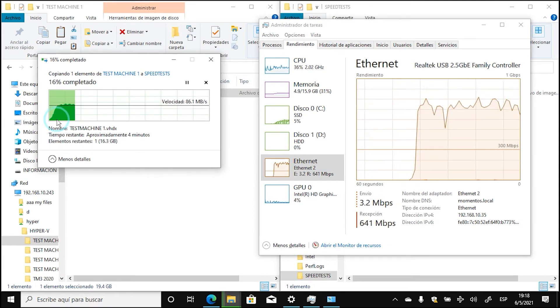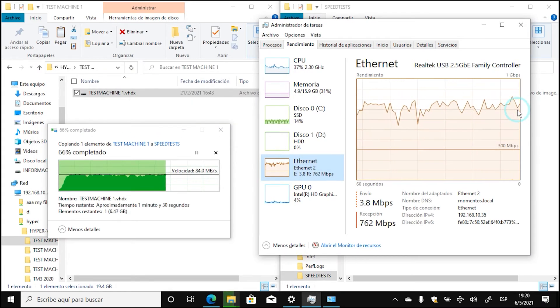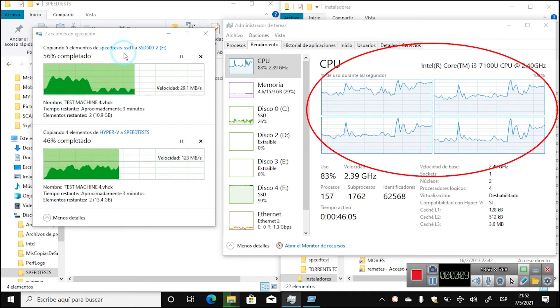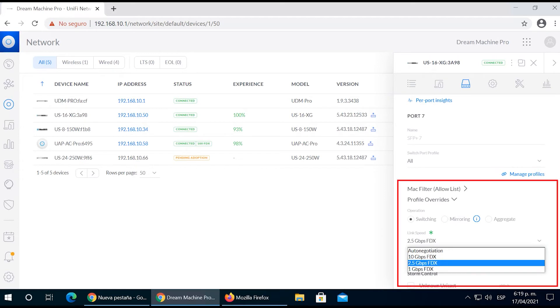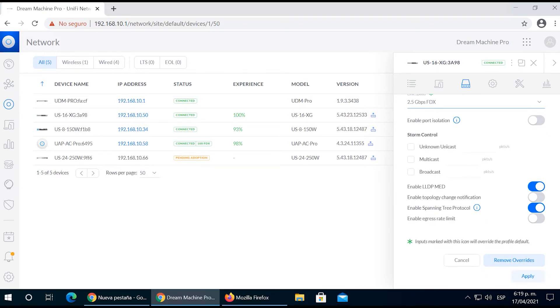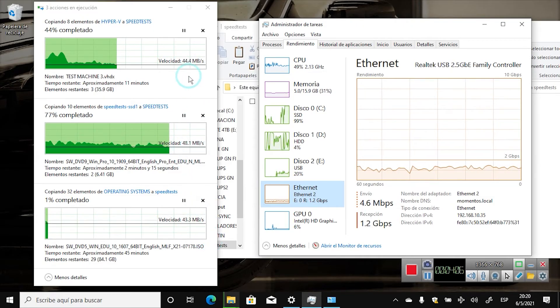In our case, the connection did not come up at 2.5 gigabit — it didn't even behave as a 1 gigabit connection. We went very deeply into testing this device to give a complete perspective. We noticed the processor became very stressed, meaning this device relies heavily on the CPU. We even deactivated BitLocker to give the processor more freedom. We also had to manually set 2.5 gigabit full-duplex in the network controller settings for the specific port.